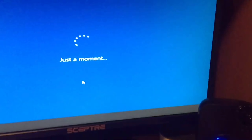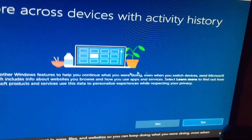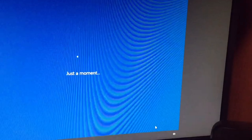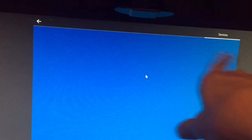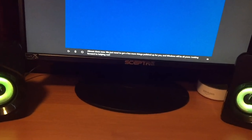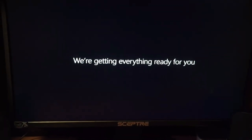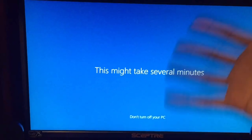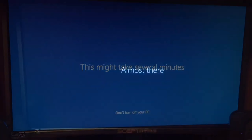After the setup prompts, type in your PIN twice and press OK. Then press 'Do it later' when prompted for optional features. The PC may restart once more as part of the setup process. After everything loads we're finally in Windows 10 — the build is complete!